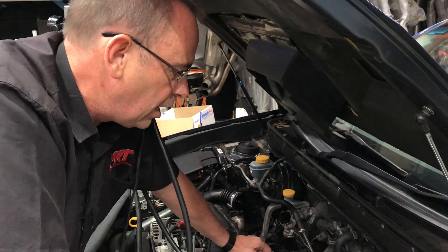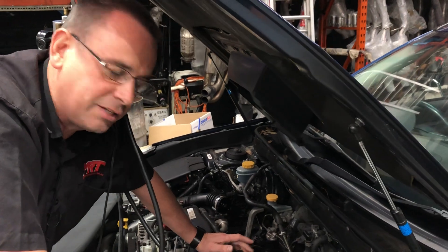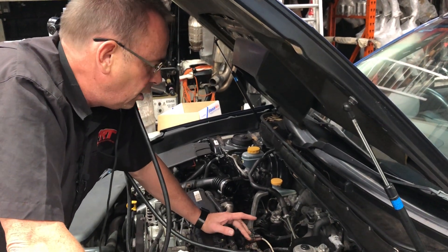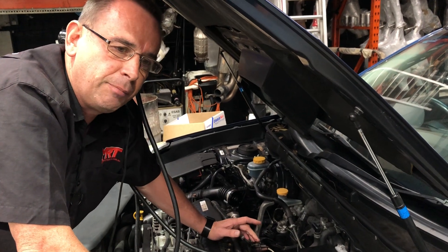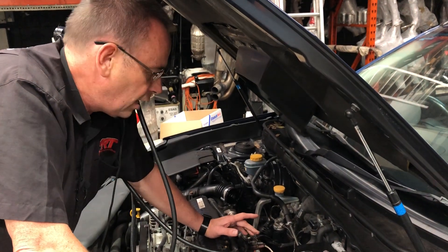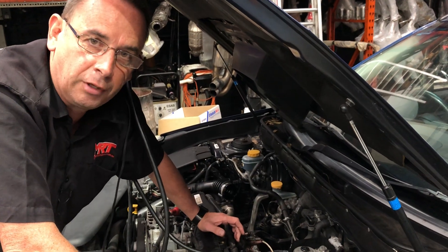In this case the car is okay, but historically it has been used in the city excessively. It hasn't had an opportunity to run its normal course of events to do its own passive regen of the DPF, and that has now manifested itself in the VGT turbo problem.